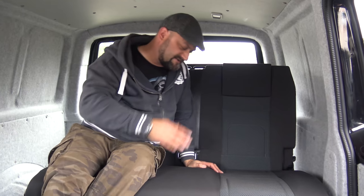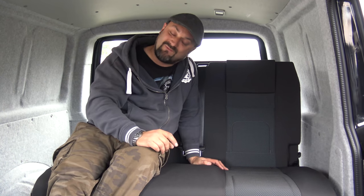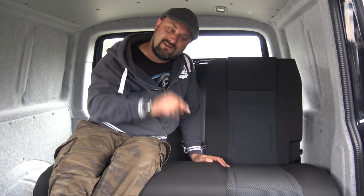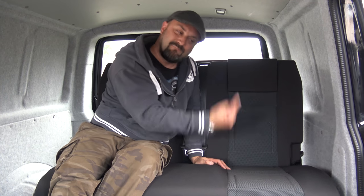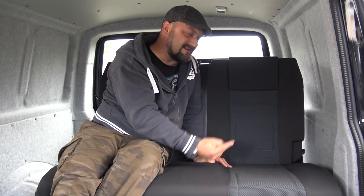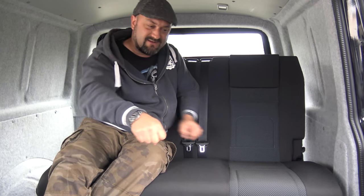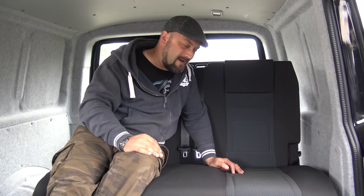Where we've positioned the seat and drilled through, there was a brake pipe that was pretty close. So obviously we drilled from the bottom upwards for that one. We didn't want to miss that and hit the brake pipe. And that was our pivot point, that was our starter. We knew then that we were in the cross beam, and we knew that if we were to bolt the bed down and just spin the bed around, then that would give us the pattern for where to drill the other bolt holes. And then we could drill down, which is much easier than trying to drill up.